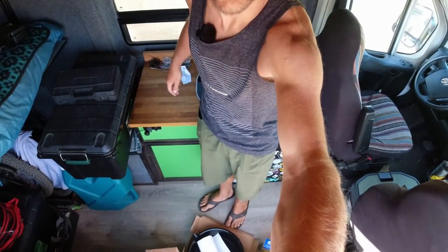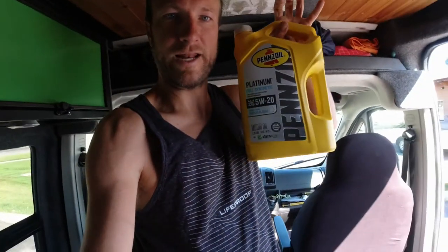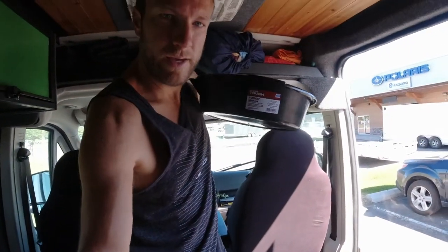First step is find your oldest set of clothes because you're gonna get a little dirty crawling around. What you're gonna need is a half-inch wrench and a little shorty 15/16 for the oil filter. Then we have six quarts of full synthetic 5w20 for this vehicle, a Mopar M0349 filter, and the three dollar oil drain pan from Walmart.